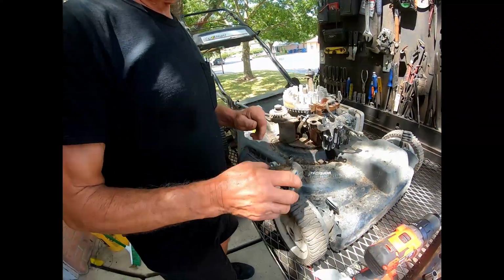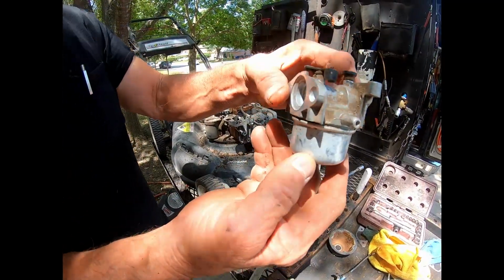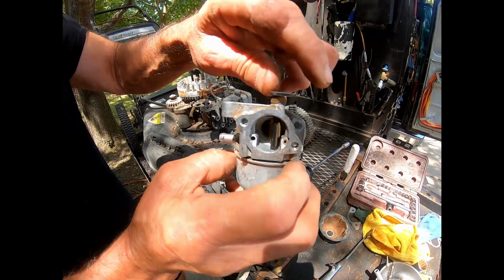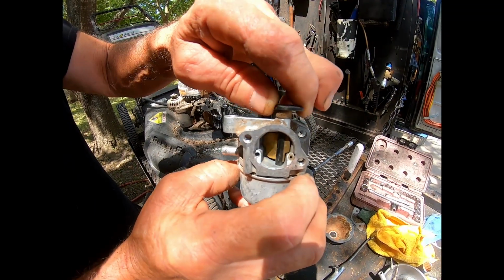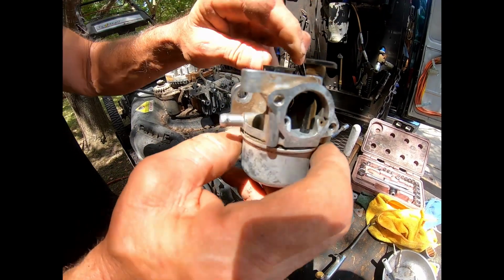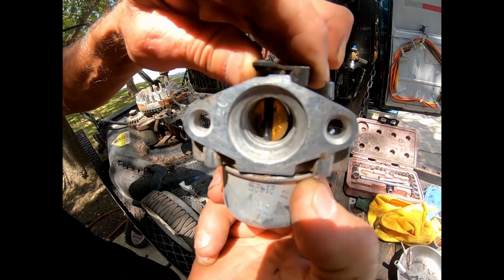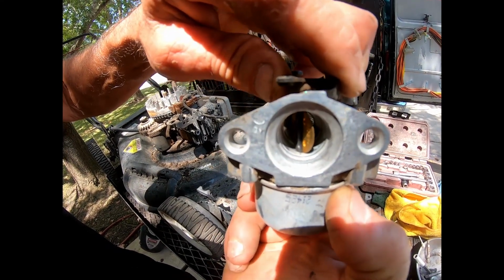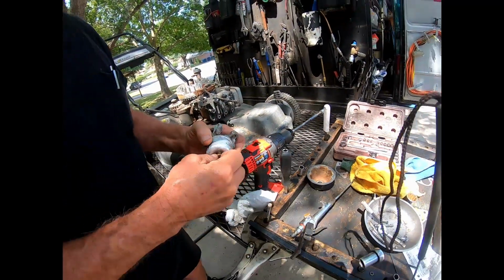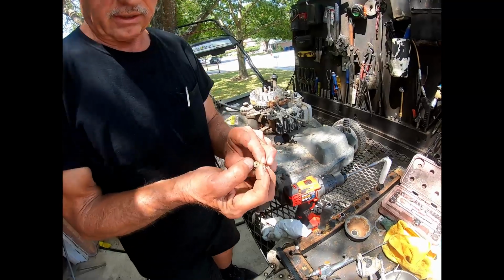So now, to continue on the function of the carburetor, this is one that's a little better. Here's the choke. That's the piece that the heat pulls the choke off. This is start. It goes here, the air partially open, it warms up, and then it opens all the way. Then this runs off what's called a governor. We'll cover that in a minute. And it will regulate the amount of air flowing in, which governs how much gas is picked up. The fuel, so that it doesn't pick up a huge dump of fuel, this is called a metering jet.